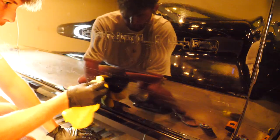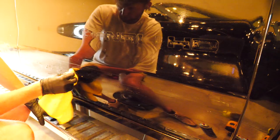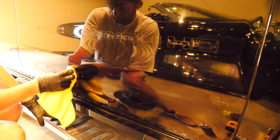It was the lines, so you know that paint had been untouched for 5 or 6 years. So that was going to be a challenge in itself, blending everything into the swirled paint. But what I was worried about was doing multiple steps in those sections where the lines were, and then not doing a full correction on the rest of the paint. So to get the lines out, this really isn't a how-to, but I took a Meguiar's cutting pad, my dual action, and just some compound, a 1500 grit removal compound, and got the passenger side door lines off, no problem.